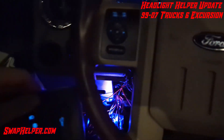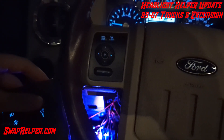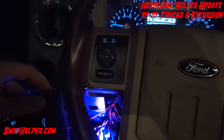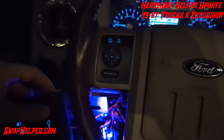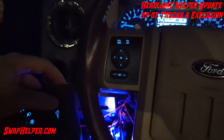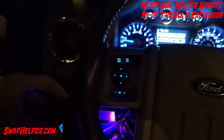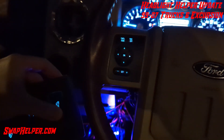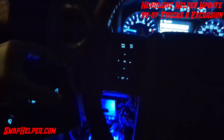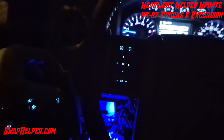You can see the cluster is pretty dim and the lights on the steering wheel are very dim. If you've ever used an 11-16 headlight switch, you know that there are basically two detents in either direction. You have the first one, which is illumination, and you press it down further if you want to turn on the overhead console lights. We'll press down to the first position and you'll see the dimming coming up — there you go, it's now at full brightness. You can stop wherever you want, then press down all the way into that second detent.